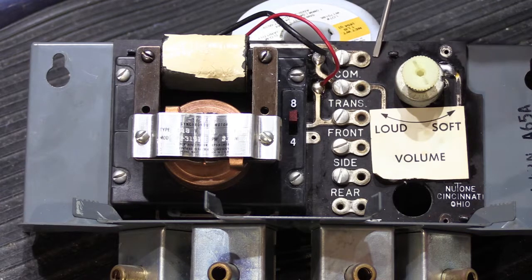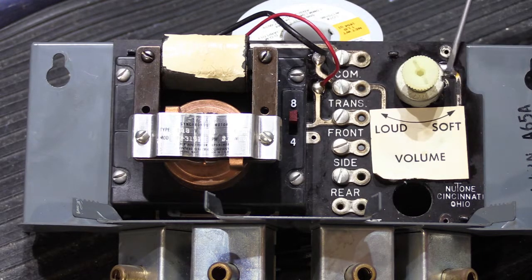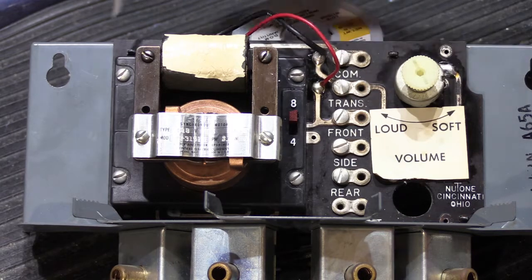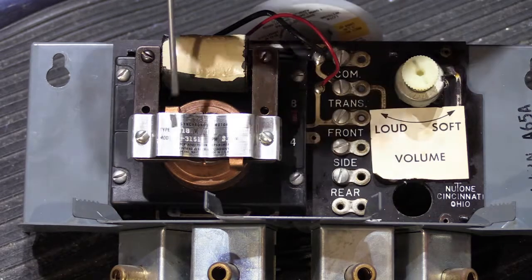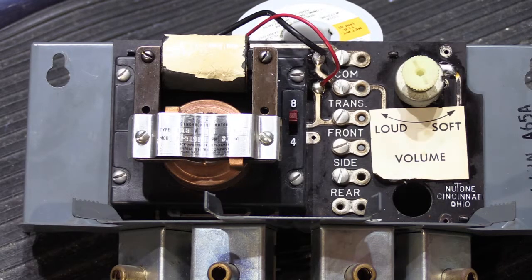The L model has a black circuit board with different connections for power and button wires. The volume control is soldered onto pads on the board, and behind the motor are the circuit traces that allow the motor's armature to make the proper connections to make the solenoids fire in the right order. These boards are some type of phenolic resin — an early type of plastic. Down on the board it says 'NuTone Cincinnati Ohio' with the NuTone name with the big uppercase T — the same chime indication label used on all NuTone chimes going back to the 1930s.